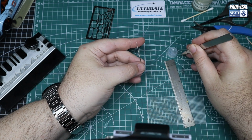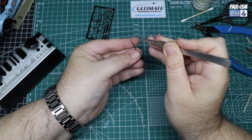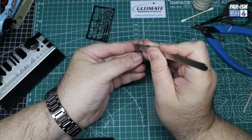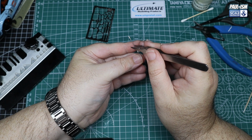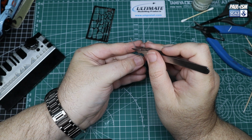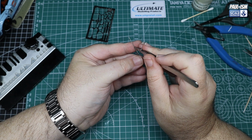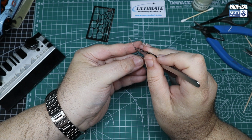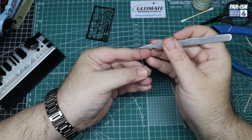And then the blade itself, I just touched ever so gently in some Bob Smith's glue. And it's a nice, simple blade, this one. Just line it up. Get a bit of purchase on one piece, and then push it down on the other. It can take a couple of goes. But once you've got it, you can repeat that for the other side. They're pretty similar, the wipers. One's a little bit shorter than the other.